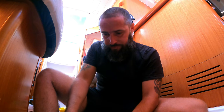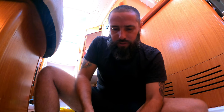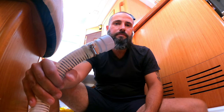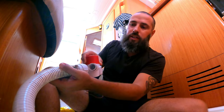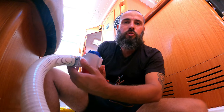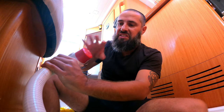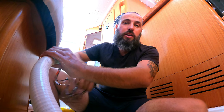Let's close the screw and make it tight with the clamp, to make sure that everything is in place. The pumps give some pushes when they're turned on, so it's good to have the hose clamp properly in place. Now I'll just insert the pump and twist it in — seems fairly easy. The next step is to connect the cables you can see here.